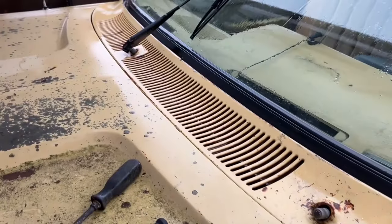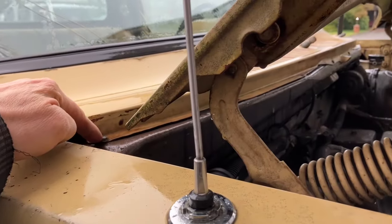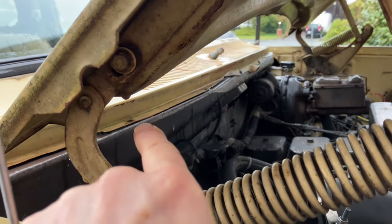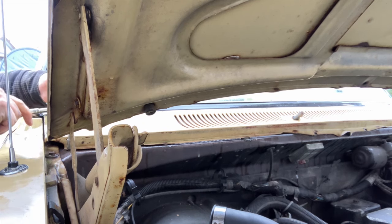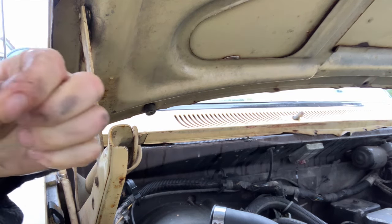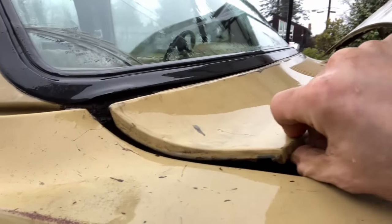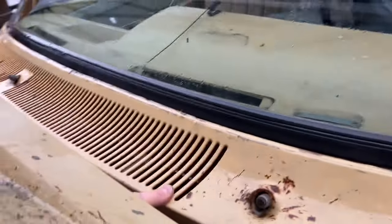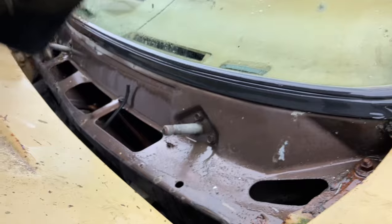Okay, now once I get both the wipers off, I can go ahead and remove this cowling here, and I'll be able to see those two top bolts on the fender. We've got a bolt here and screws all along the front. I only have two screws in the middle — these ones have already been removed by somebody. Got the middle screws out and the one on the far end. The last one you can kind of see on the side of the cavity. Now that whole cowling is loose — it just slides right out of there. I've got to remember it slides right back up in there on reassembly.